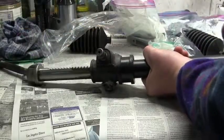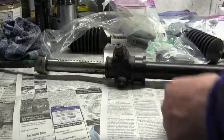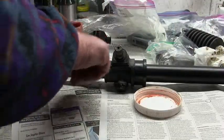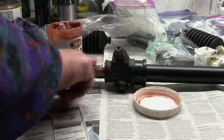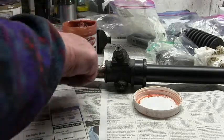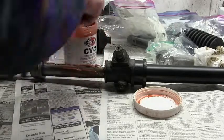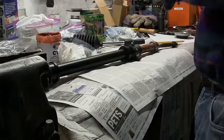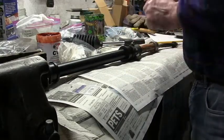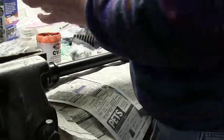I'm first going to push the rack out and add grease here. This is probably the worst way to do it, but I can't think of what else to do. I think what I might try and do is take off the oiling nipple and see if I can get some EP90 down there. I think I took this off before and cleaned it up.